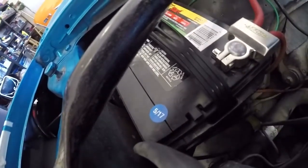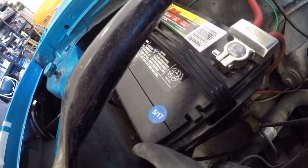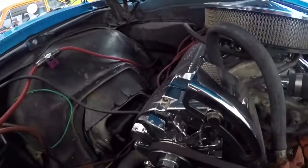A good indicator is the sticker right on the battery. The last one said five of twelve, and they usually have a shelf life — especially on something like this — of four to five years. Keep a battery tender on it and keep it charged and you can extend that. But with it being old and sitting a lot, the battery tends to run itself down. We have a bigger alternator on this because of the sound system, which I still haven't decided what we're going to do with. Thanks for watching — any questions or comments, put them below.